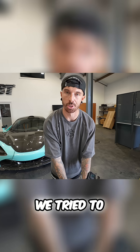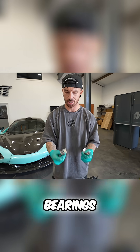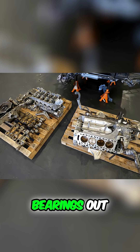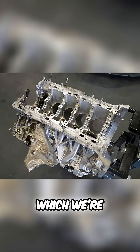So it's vital we get this right. We tried to order new bearings, but Aston Martin don't sell a lot of the internal parts of the car, including stuff like bearings. So we're being sketchy, and we're going to be taking the bearings out of the old engine — which luckily are all yellow bearings as well — and putting them in the secondhand block which we're building up.